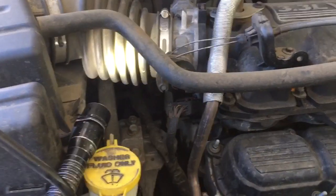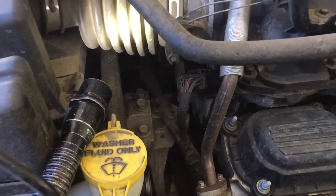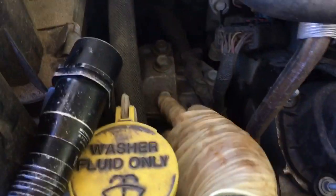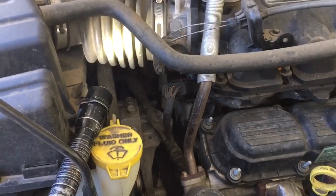Alright, I've got the water pump and the pulley loose on the bottom, but I'm hitting the fender well. I think what I'm gonna have to do is stick a jack under the oil pan, take these 3 mount bolts loose, and see if I can lower the engine enough to wiggle the water pump out of the way.